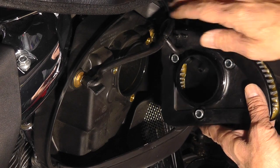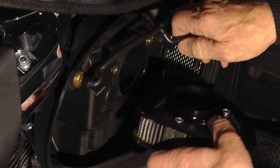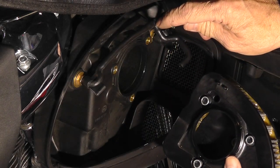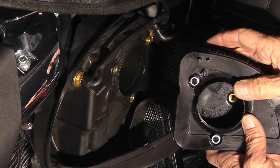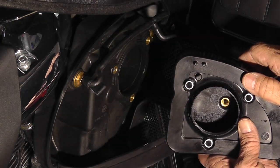I'm gonna pull this tube out right here and replace it, probably with the kit tube to go to the catch can. Also this hole right here — I'm gonna have to plug that hole.